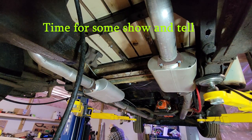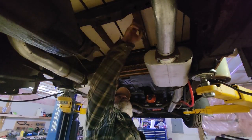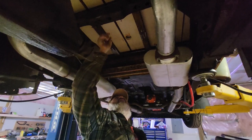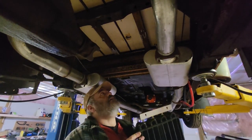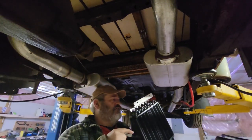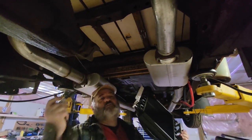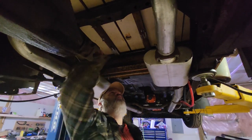I thought I heard a big old diesel coming in the driveway. Visitor checks out the build — it looks good, wants to put a bumper on it. So we'll measure this up. I could just do tabs but I'm going to go all the way across and weld in some flat bar and drill some holes to get that put on. It's funny — people will build some giant quarter-inch thick plate steel brackets but they don't realize you're only screwing into one-sixteenth inch aluminum sheet metal. If it's going to rip off it'll be the sheet metal — you can build those brackets as solid as you want but that's still your weak point. So there's no sense over-building.